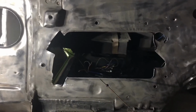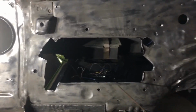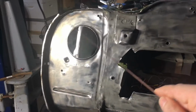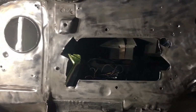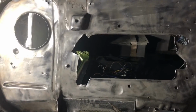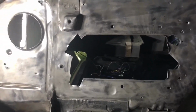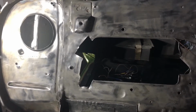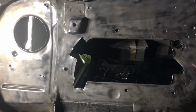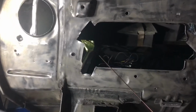Part 2, or Operation 2, Part A, is flattening these edges out. So I have a plate that kind of covers this whole thing and comes down and even covers over here. It's an AC delete plate. The car won't have AC for the time being. If in the future I go with a vintage AC unit, the whole unit is contained in behind the firewall, so I won't need this hole really to be back like that. So somehow either using some clamps or something, or cutting this off, I'll make this flush so that panel can fit flat against the firewall.